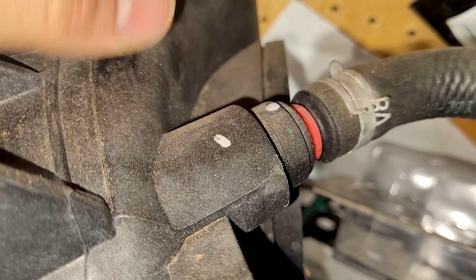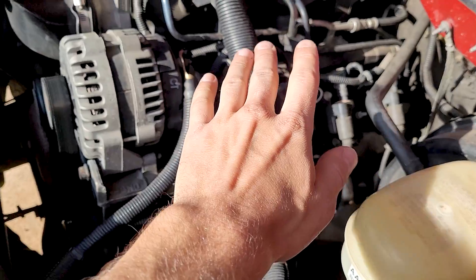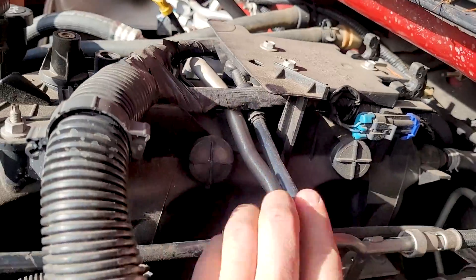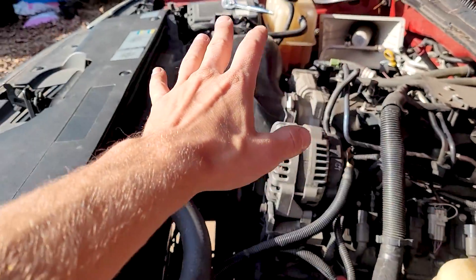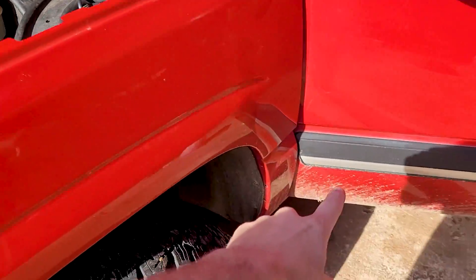You've got this other spot out back right here — I haven't really had any problems with that, but the hose does crack. There's a vacuum hose right up here that goes down to the EVAP and it can leak. That's pretty much it for the top side up here in the engine bay. Down here at the gas tank, there's a lot of vacuum lines and nylon lines that go all over the gas tank and the EVAP — those can be a problem. Make sure they're not chewed up, burnt up, cracked, or broken.